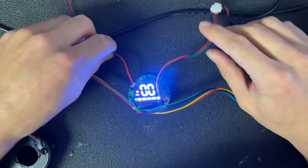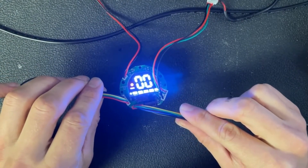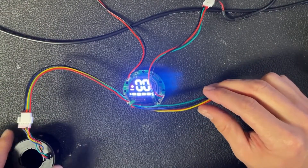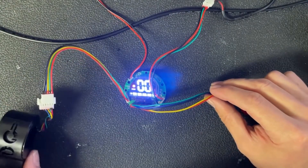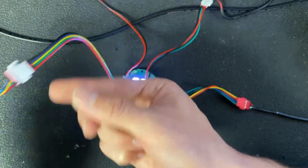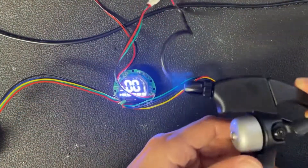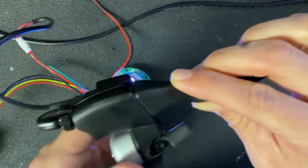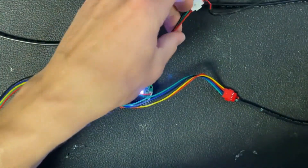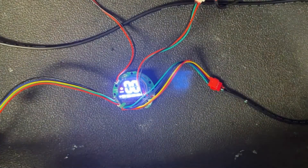We're going to be showing you how to replace the LCD top unit panel which controls the throttle input, the brake input, and the headlight on the scooter. Before we show you how to do the replacement, I want to show you how the different components line up. You've got your throttle here, which plugs into a white five-pin molex connector, and your brake cable, which uses a three-pin molex connector. The e-brake is activated by a sensor within the brake handle, so it runs through a digital signal. The last connection goes to the controller through a hall cable.